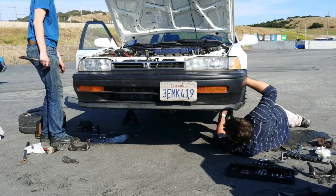I had a really bad issue with the brakes. And at the same time that the brakes were getting cooked, the alignment was getting screwed up in the front. So I was trying to fight to keep the wheel going straight, and it definitely wanted to veer to the right really bad at the end of the third run. The worst issue was the brakes. So the brakes I definitely cooked in the front, and I ran out of pad on the outside on the driver's side. So I'm going to need new rotors now, but I had to get new calipers and a set of new pads and replace them at the track before I went home.